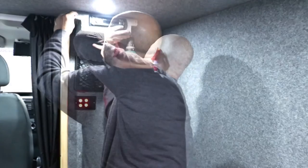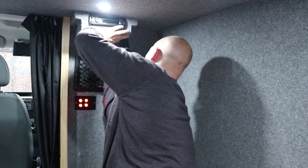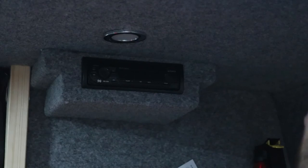As I previously mentioned, I drilled down into the wood first before I covered it in carpet, so there are some holes there ready to accept the screws. The screws should pop straight through the carpet and the carpet should seal around them, meaning you can't see where I've actually put the joints in. I'm happy enough with that — that will work. The cables are through the other side of the bulkhead. Tomorrow's work will include putting some fused power to that and then I will need to install the speakers and run speaker cable from the speakers to the head unit.